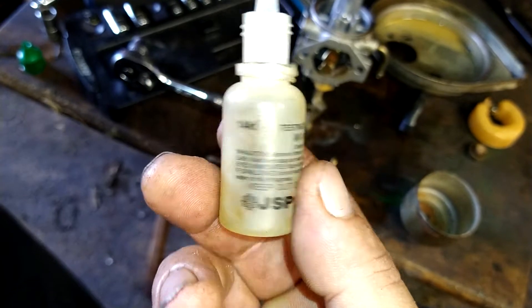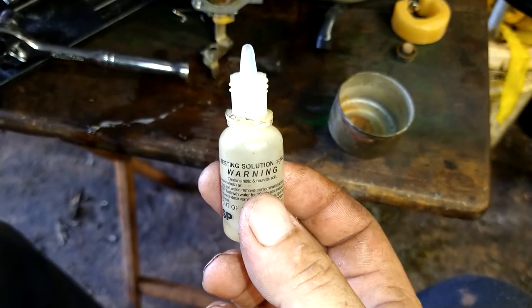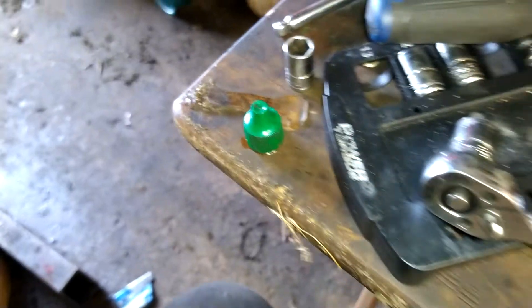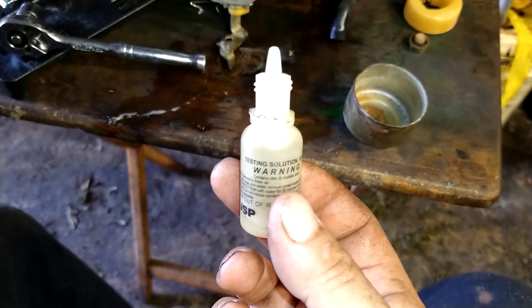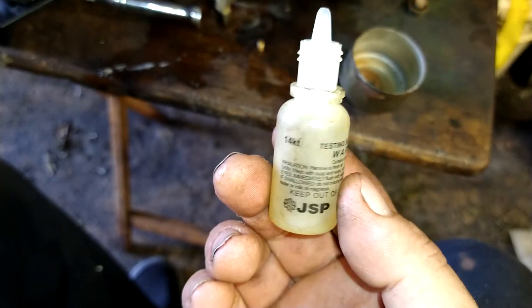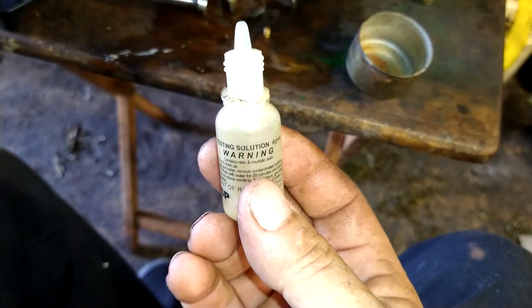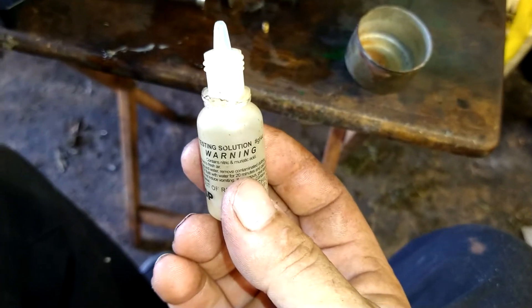This is 14 karat testing solution — it is an acid. GT44. If you get this on your hands, it'll burn your skin. If you get it in your eyes, it'll burn your eyes out. Wear safety glasses, wear gloves. It'll be the green top one. I've tried all of them — some will eat the brass, some will eat the aluminum. This is the only one that works properly. Don't try other stuff thinking it's going to be better. I'll put this in the description below. Be very safe — if you get this in your eyes, just rinse with water. Get it on your skin, just rinse it off. Don't panic, just be smart. Keep a bottle of water next to you and rinse right out instantly.